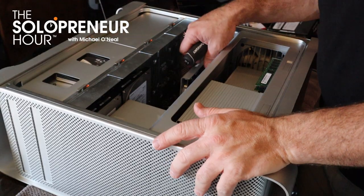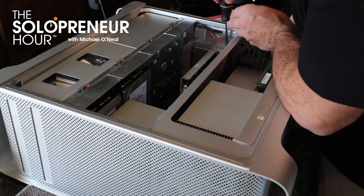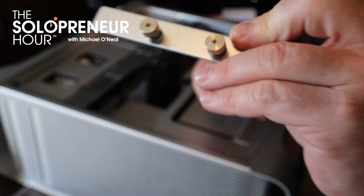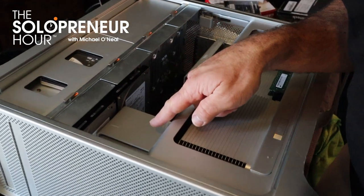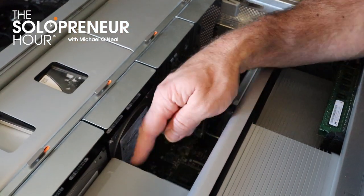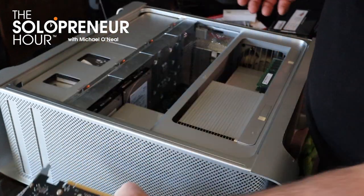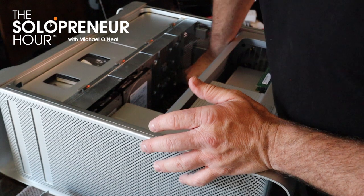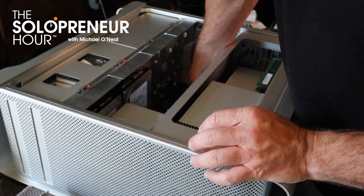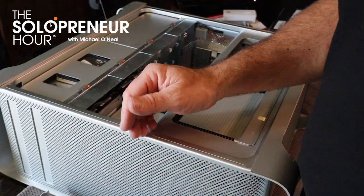I'm working on the PCI slots now - there are two video cards in there. They have little hand knobs but also a Phillips screwdriver top. The locking plate goes first. The PCI boards are locked in with a little plastic piece that has a button on it - if you push the button the entire piece slides a quarter inch and the PCI cards are unlocked. This one has two video cards. I'm also going to take this moment to replace the PRAM battery that's been in here for a long time. It's the Panasonic 2032 - might as well replace it while you're in here.